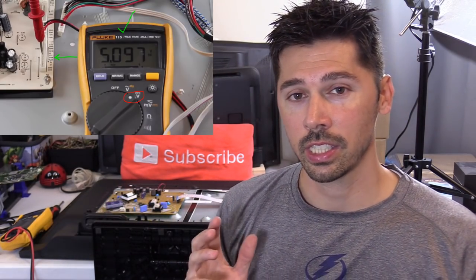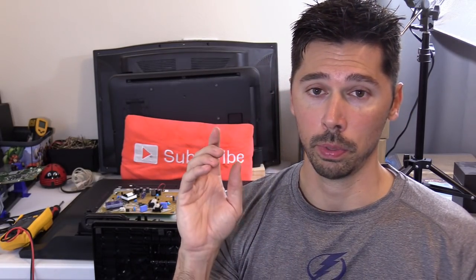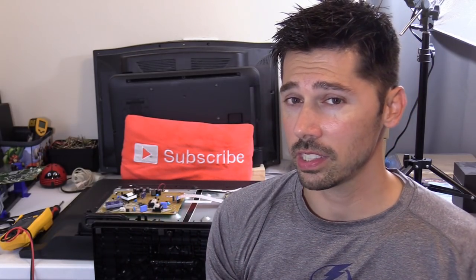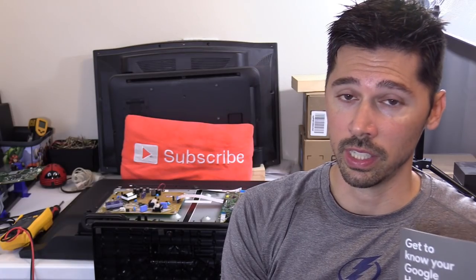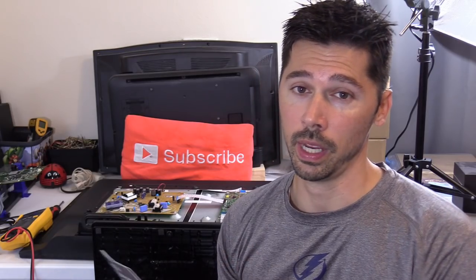We're not going to be using the voltmeter — there's another way to check the standby voltage by looking at the TV. If the TV is dead and has no power, whether you press the power button on the remote or the TV itself, but you do have a standby light on the TV — that little red glowing light on the front — that usually means the power board is working and the main logic board is defective. But if you have no power and no standby light, that usually means your power board is most likely defective, and/or your main logic board is bad.